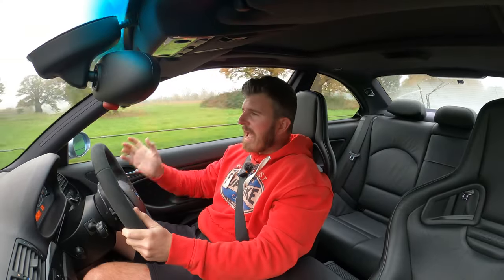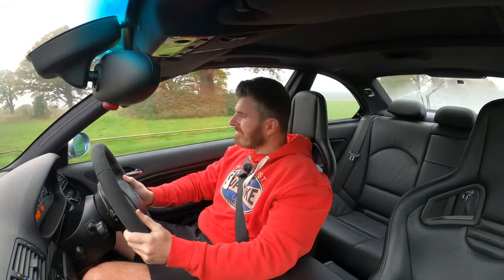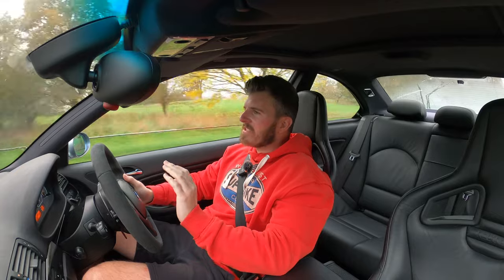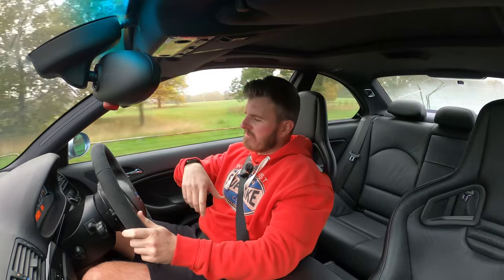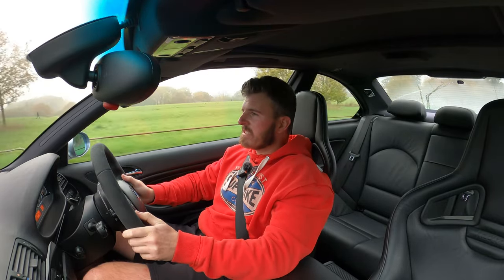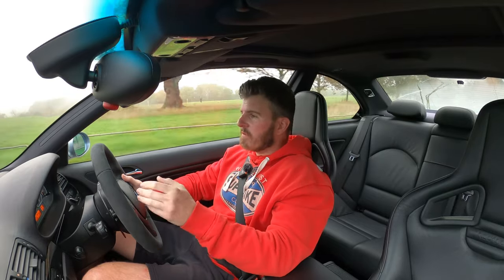Good morning, YouTube, and you join me on a lovely cloudy Sunday morning in the UK. The E46 is done, as you saw from the video, relatively speaking, pretty straightforward to swap it over. I've shredded my hand to bits trying to get under the airbox, and we had that issue with the air inlet temperature sensor, where unfortunately it was calibrated to run with another aftermarket one. And at that point I was like, I don't know how I'm going to fix this on the driveway, this is a coding issue. But I did remember seeing something from a company called ECU Works, and went on the website. There it all was, ready to go.